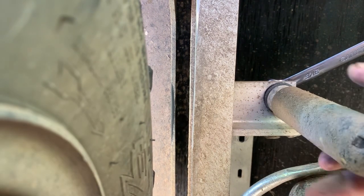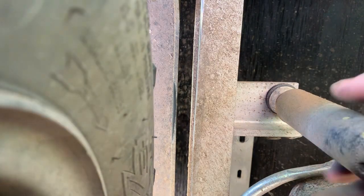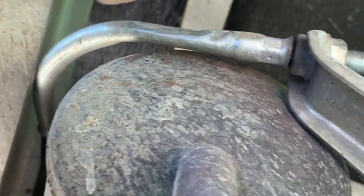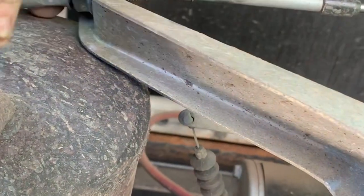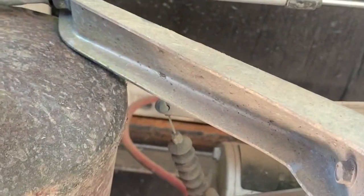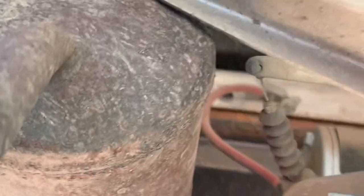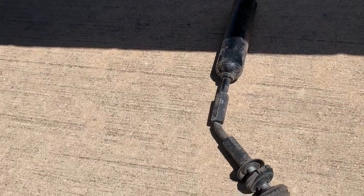You see how this shift cable has all been pushed in? It's actually rubbing the muffler. I wonder if this bracket is bent — I'll have to look at another one I've got at the shop to compare. I think this bracket has been tweaked. There's no way all of that should look like that. That's how far it bent before it broke.